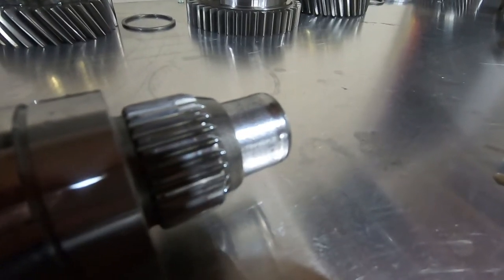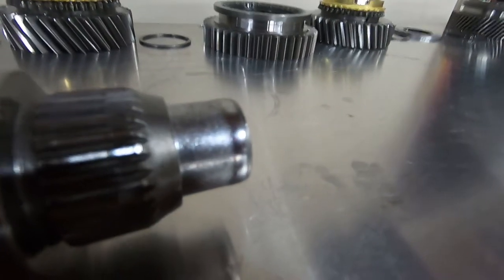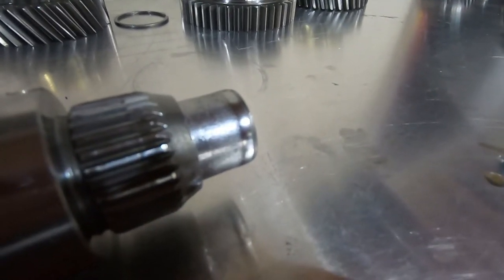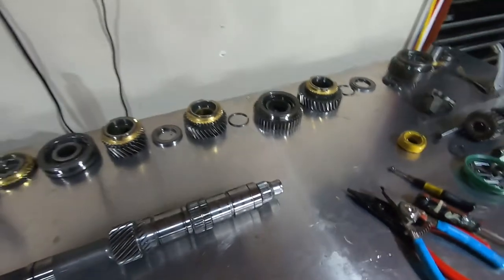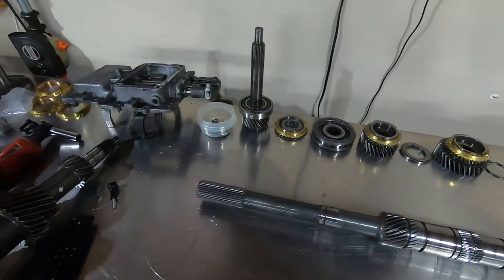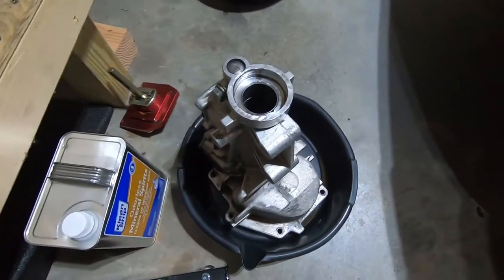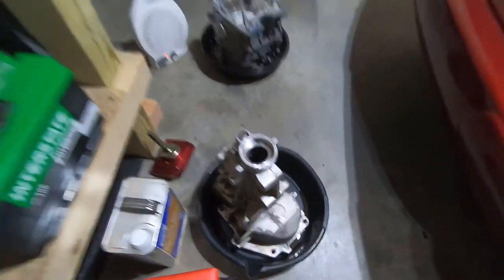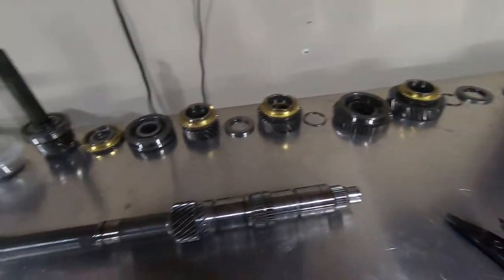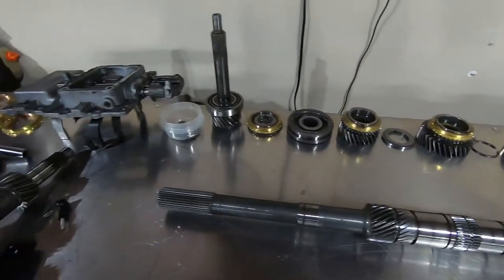Here's another closer look at this main shaft pilot — you can see how pitted up it is. There's no fixing this. It's not worth it — I'm just going to have to go buy a new one. But this is what we're left with, so now we just have to clean everything up, put it back together. Case, tail housing, main case — now let's just clean up, get a couple of parts, get some O-rings, and put it all back together.